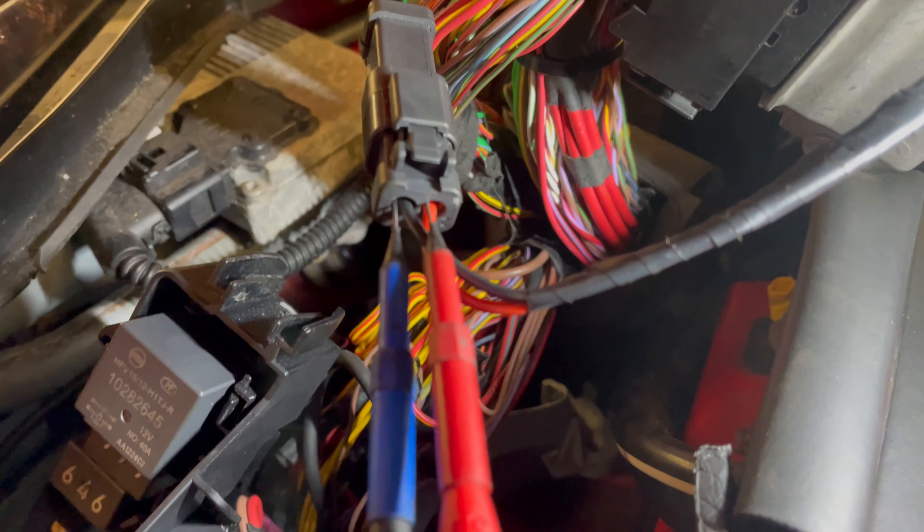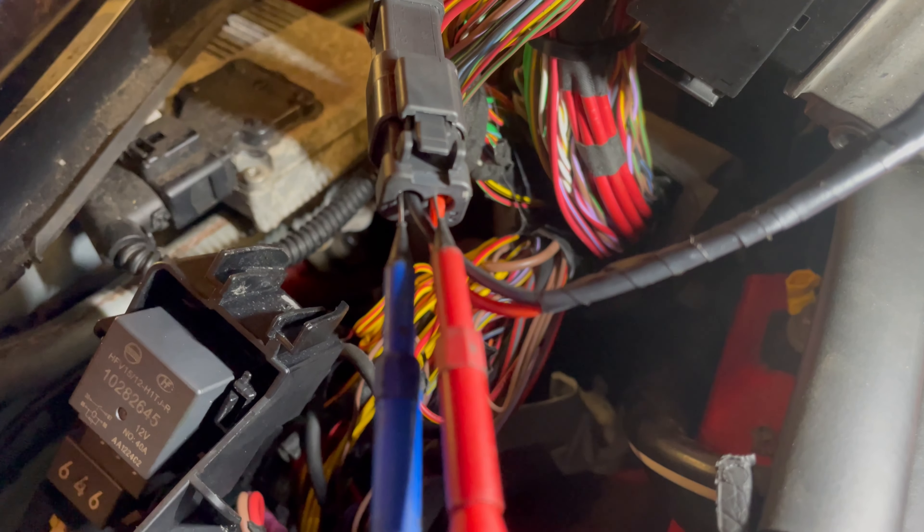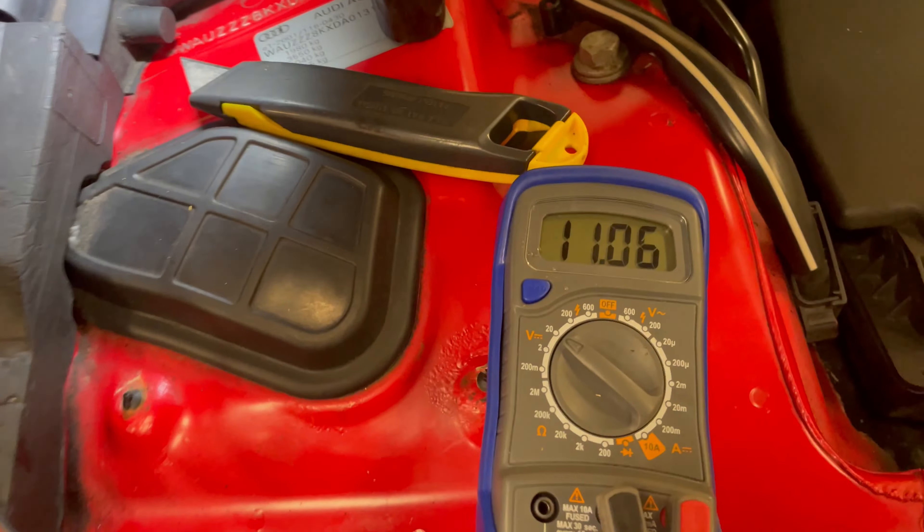Second check: go across the consumer that you want to check if there's a voltage drop on it. Make sure it's connected. Alright Dave, crank it.